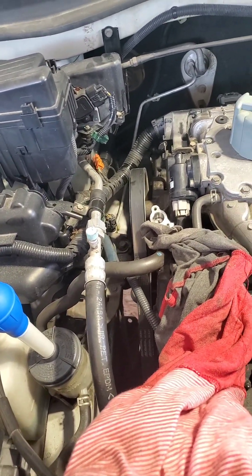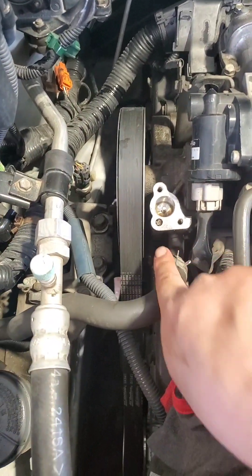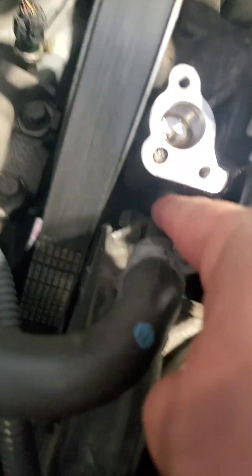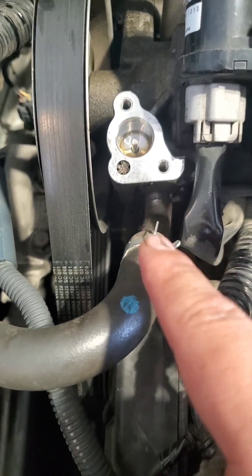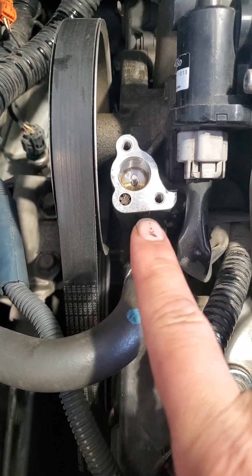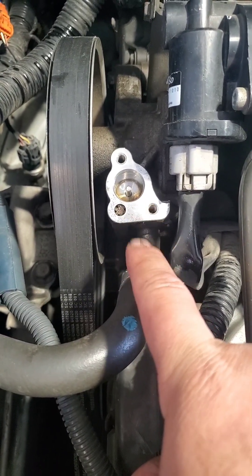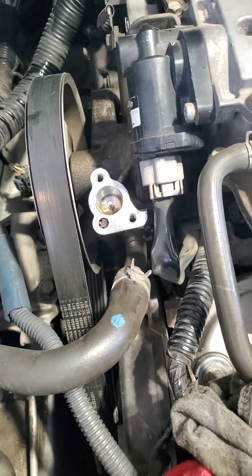Fill the reservoir back up — I'm gonna flush mine but fill it back up — turn the truck on, then turn the wheel both ways maybe two or three times, and that should take all the air bubbles out of the system. If your line isn't leaking but you hear whining from the pump, it's an O-ring that goes into the feeding line that goes into the reservoir. Just take the bolt that's right under there, take that out, change that O-ring — it's like a three or four dollar O-ring in Canada. That O-ring wears out and lets air into the pump, causing a whining noise. Before you go change the pump, a lot of times it's just that O-ring.